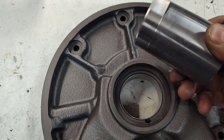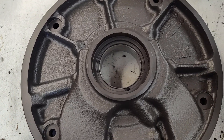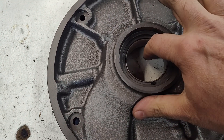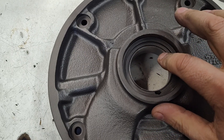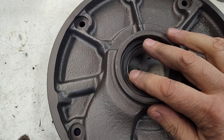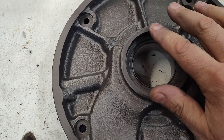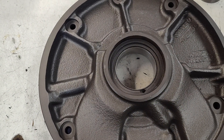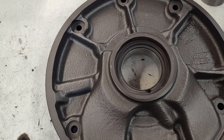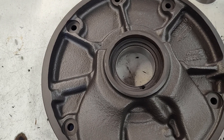I don't like that. What's going to happen is when things get hot — especially a torque converter, especially if you're running a trans brake or anything like that — this is just going to expand and it's going to gall up in here. This bushing is going to spin inside the bore, and then you're going to get debris. The bushing may start to sneak its way out, the pump seal will get damaged, and you're going to notice a very significant oil leak inside your bell housing after running this a short amount of time. That's typically because the bushing is too tight.